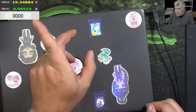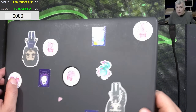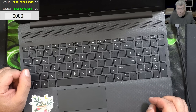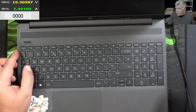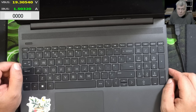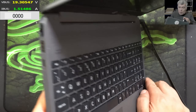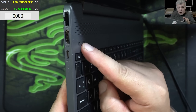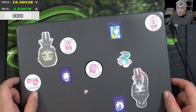You can see it's 70 milliamps, 150 — it's charging. We have the charging light, it's taking 1.4 amps. Pressing the power button and the current is going to zero. Pressing the power button and nothing happened. It's not coming on, it's not doing anything. Only once we saw the current going to zero.